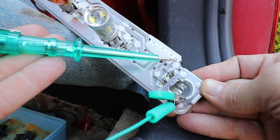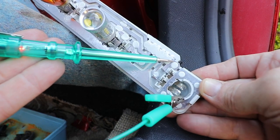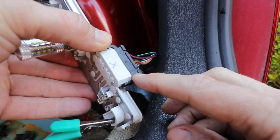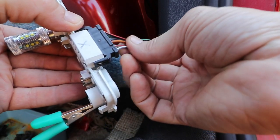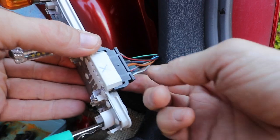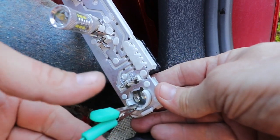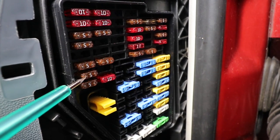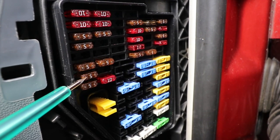If I go now and turn the fog lights on, I should see a reading on this side — which I do. If we follow the connection up and round to the connector on the back, we can see that the bottom connector connects to a grey and white wire, so this is what we need to look for on the other side. Here's fuse number 37 just here if you need it — mine's a five amp but some are seven and a half amp.